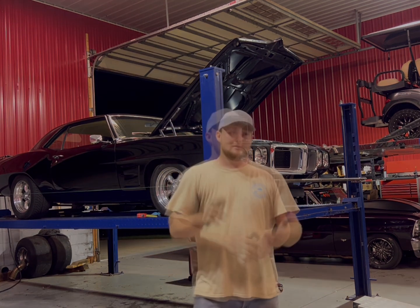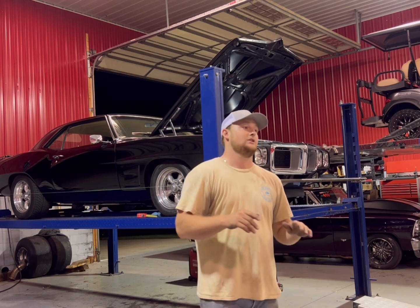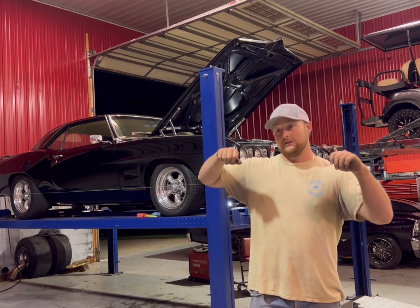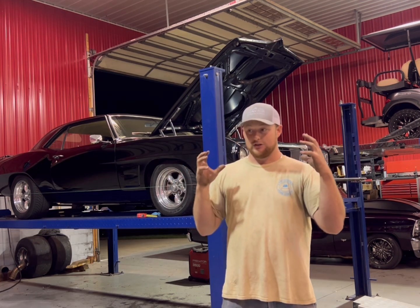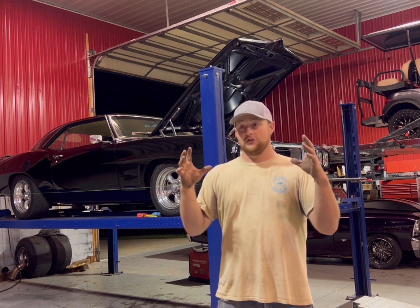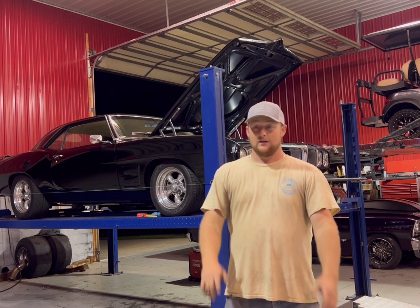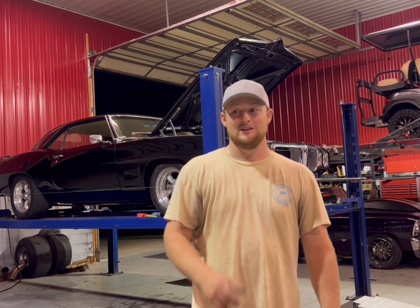I'm telling you right now, if you get into it, it's not hard to do by any stretch of the imagination. And I see so many guys, all the time at the track, they take 2 tape measures and they put one in front of the wheel and one behind the wheel, and hook them on the rims, and there's 2 guys and they're measuring and guessing. And it's better to square the car and then try to set the tires to what the chassis is. We're not even worried about body panels or anything like that. We're squaring just to the actual geometry points of the car and getting our steering right off that. I didn't say it earlier in the video, but also make sure your steering wheel's straight before you do too much of this, because that's really annoying.